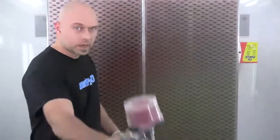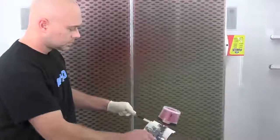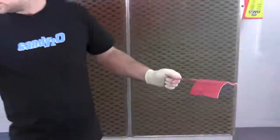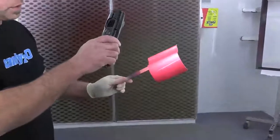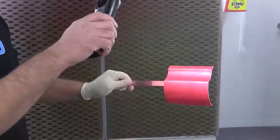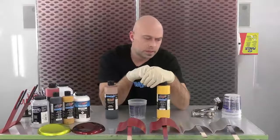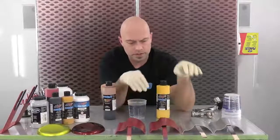Color is ready in the gun and this is coat number one. As you can see, it is a metallic red — a little bit of a rosy color on the first coat — but it's got a really nice sparkle effect due to that silver sealer. I'm going to go ahead and do three coats of this. We are all done spraying our base coats. This is the red, totally dry, and this is the silver, totally dry.